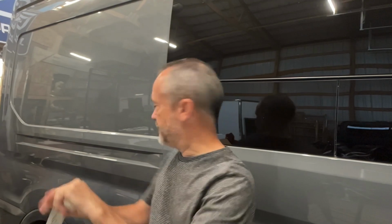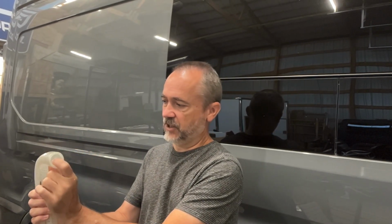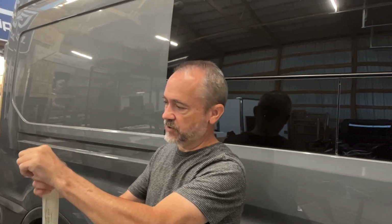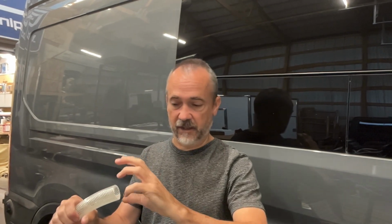The hose was giving us trouble with the connector, the original water fill connector we're using. Because the hose is reinforced, when we were getting it in there, because there's only so much room between the inner wall and the outer wall here, about 5 or 6 inches. Once we put that on there, even though it was sloped down some, it was actually closing off. So by the time we put that in there to get that to close all the way in there, it was closing off almost completely and folding over. That way we weren't going to get any water flow down there. Also, because of the tension on this hose, it was actually trying to loosen the 2-piece part of that water fitting. I didn't like that.